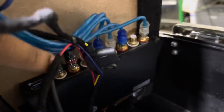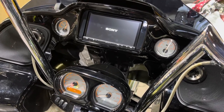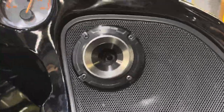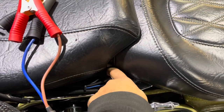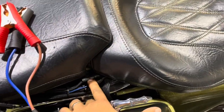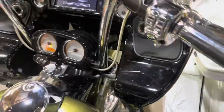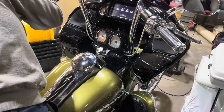So we got to fix that. We're going to replace these RCA cables. I like these, I don't like those. We got some crazy noises coming through all the speakers. And then if you touch here, the noise gets worse. So that's what he's hearing as he's driving.